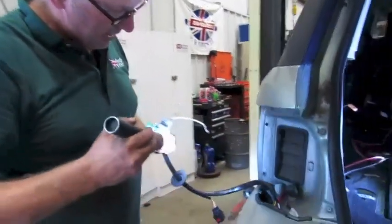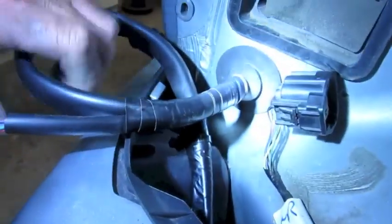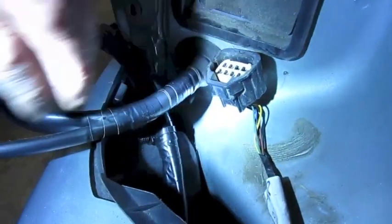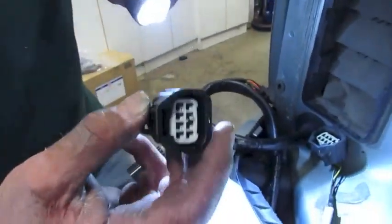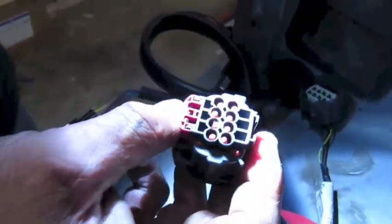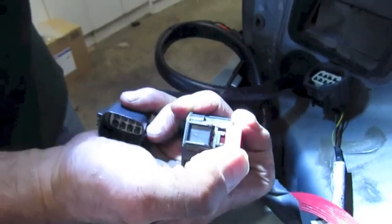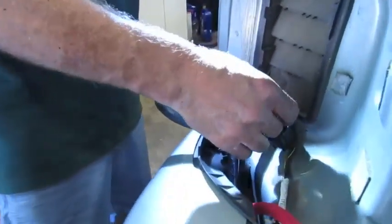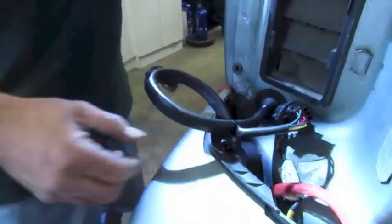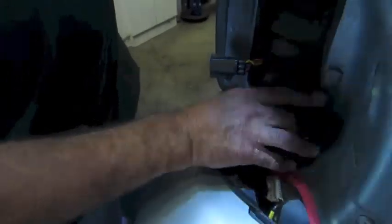Everything's pretty much colour coded or size coordinated for the interior. The grommet is installed into the rear of the vehicle, nice and uniform. This is the wiring for the park distance control on the back of the vehicle, and this is the connector to it from the new harness. The new connector for the park distance control comes with a blanking plug in the end — you can see the little red rubber grommets inside that blank off any water getting in. This has to be removed: slide the little slide back, press on the little latch and pull, and it will come right off. Then the connector goes back into the main harness and clicks into place. Any residual extra harness will wrap up and form nicely behind the lamp unit.